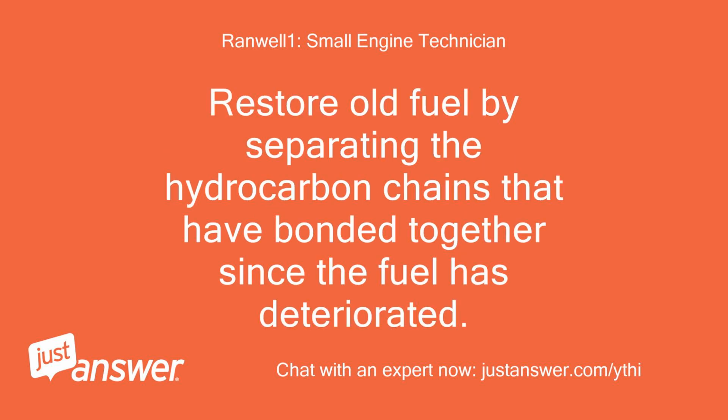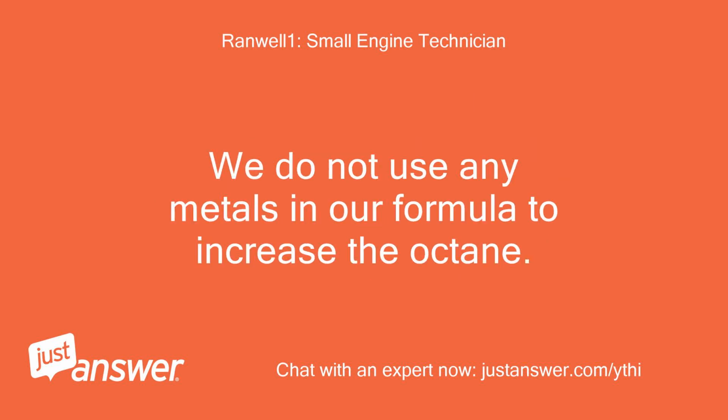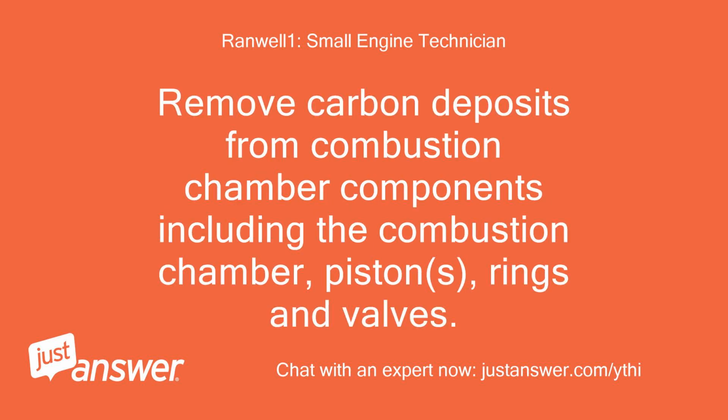Restore old fuel by separating the hydrocarbon chains that have bonded together since the fuel has deteriorated. An octane booster is added to replace the lost octane in the decayed fuel. We do not use any metals in our formula to increase the octane. Remove carbon deposits from combustion chamber components including the combustion chamber, pistons, rings and valves.